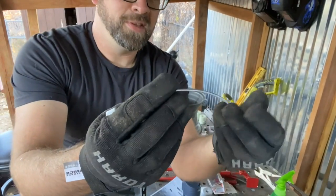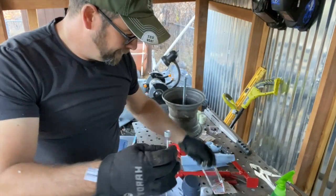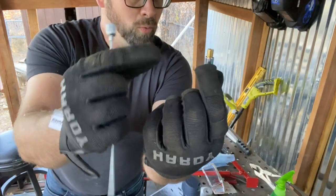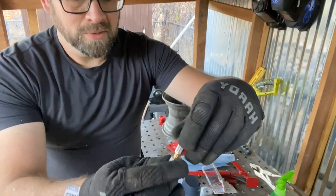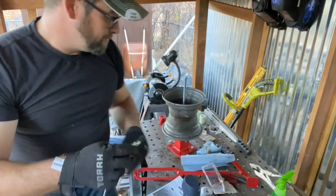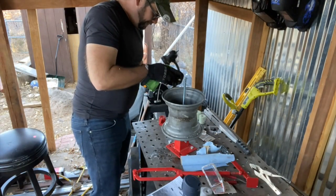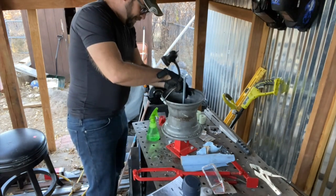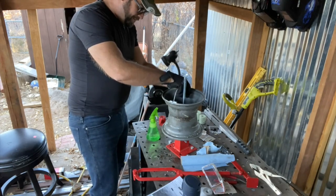All right, so here's how I think this is supposed to work. So here's a little valve stem tool from O'Reilly's. It's like 6 bucks. Here's our valve stem, about $1.25 each. Chrome, fancy, from O'Reilly's. So you screw this, you put this through, you screw this on here, yank it through, use some soap. At least, in theory, let's find out. I'm actually kind of apprehensive about this. I've never tried this before. This seems like the place where you can really screw it up.